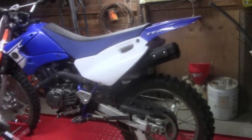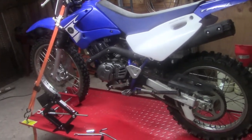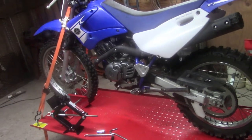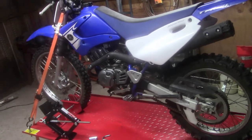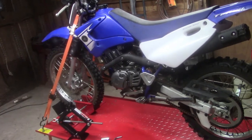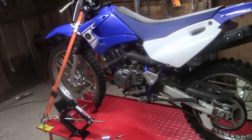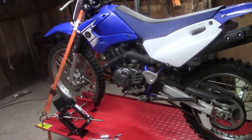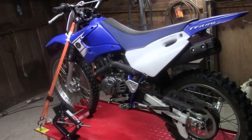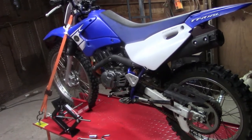Other than that, I think the biggest deal is going to be the starter problem. I don't know if the starter is frozen up — it could be the solenoid, or it could be something as simple as a fuse. I have the new battery, so I'm going to get the battery put in and get those few things done. I didn't want to scrap the video after losing all that footage. We'll get the chain adjusted, get the oil changed, and see if we can get the starter going. Hopefully you guys can hear it run and see it move around.